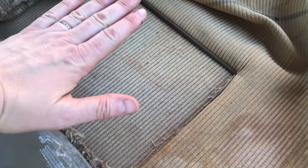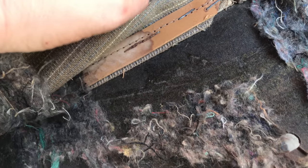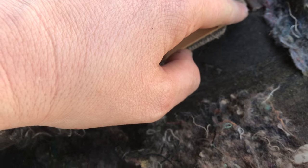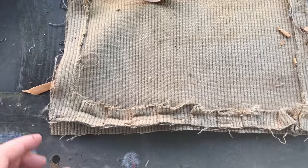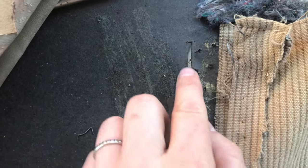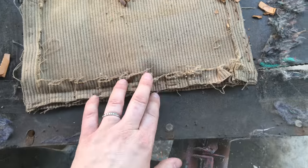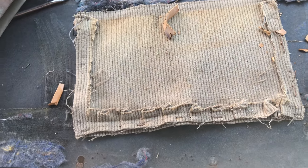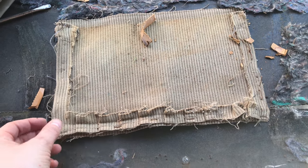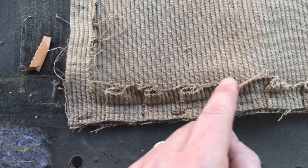Taking it further apart, the pocket piece had a gathered piece that tucked in, so there are actually a couple layers of fabric: the outer door card piece, the inner pocket, and then an elasticized flap. There's a slit cut in the card on each side where the elastic ran through. This piece is actually glued to the board, and then the gathered piece was sewn around the border of that glued piece. They gathered in one direction rather than doing a double tuck.